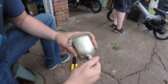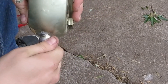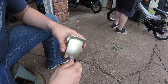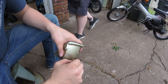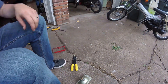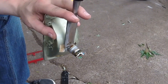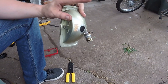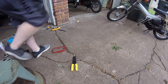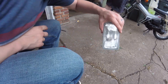Be very careful not to cut any deeper than you need to — it should only take two to three minutes and you'll see a seam forming as you cut around. Now that I've completely sawn through, the socket is loose within the housing, held in only by the bulb because the bulb is too large to fit through the hole. That's another reason we're using an LED bulb. To get the old bulb out we'll have to break it — if you pull on the socket you can see a very thin line of glass. Take a small chisel or flathead screwdriver and carefully tap it until the glass breaks. Wear eye protection. Once broken, shake out all the glass shards from the inside over a trash can.